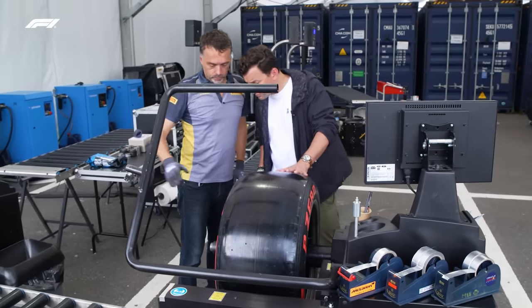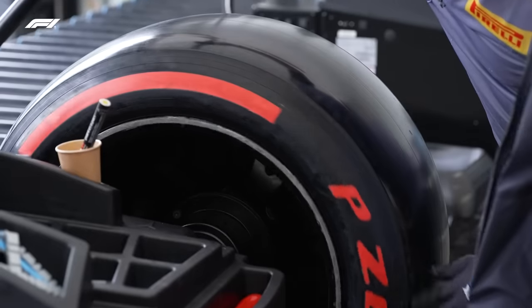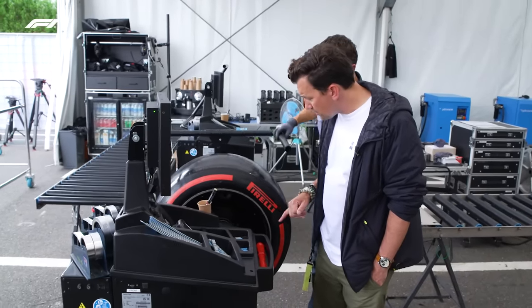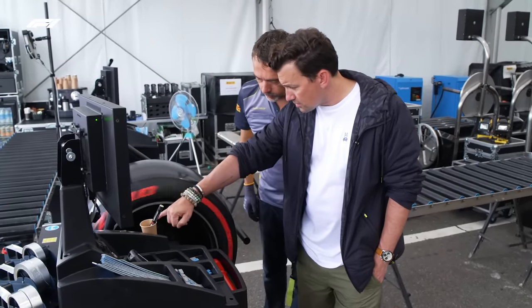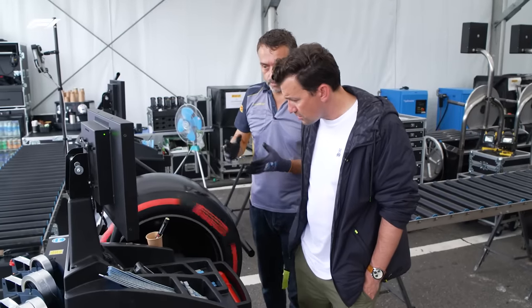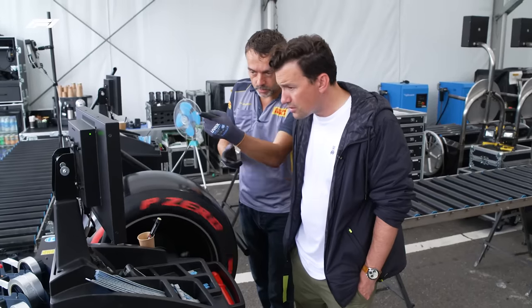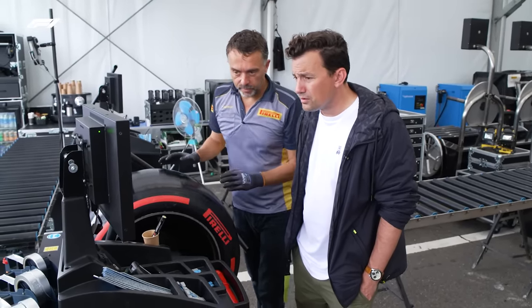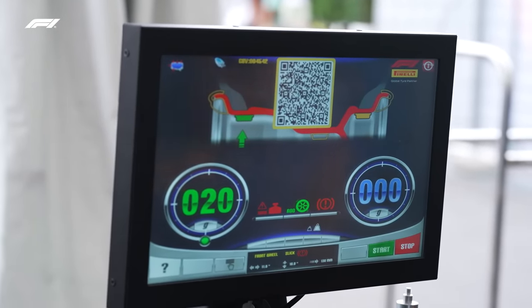It's on. So we have the tyre fixed — it's like it's in a car. What we're going to simulate with this is launching the car on the track. We put this bar as a protection and there's a little red light that is measuring the vibration, measuring if it's balanced on its weight. We will see on the screen — it says that to have a perfectly balanced tyre, we need to put 20 grams where the red dot is.